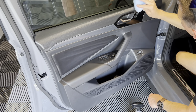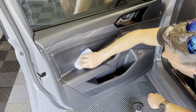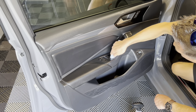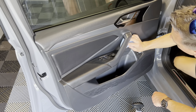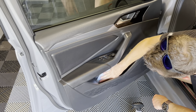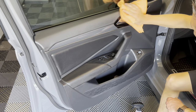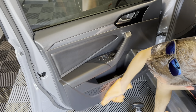You can adjust the level of shine by how much product you apply. If you want a high-gloss shine, simply apply more. If you want a low-gloss satin sheen — which is what I prefer — take a microfiber towel and buff off any excess. This goes on nice and even. It is not petroleum-based; it's water-based, but it does have graphene which makes it last a long time and really sticks to the material. It's safe for rubber, plastic, vinyl, and leather. If you want higher gloss, just leave it and walk away — it will dry to the touch.